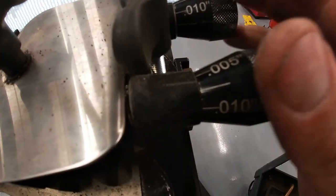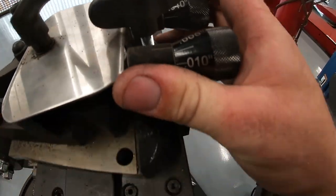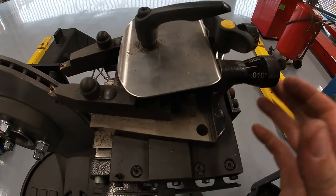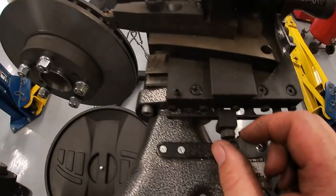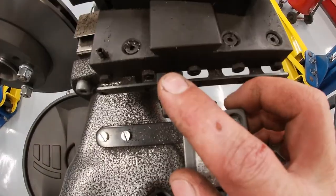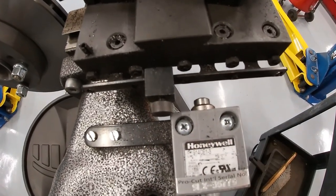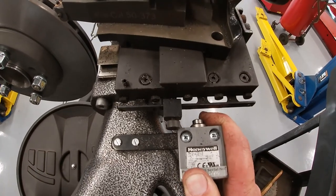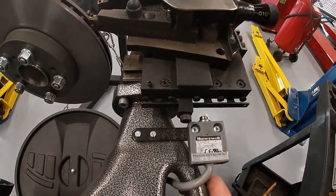The measurement adjustment is similar to an off-car brake lathe. You have a lock to move the cutting head inwards and outwards. What's different is we have this auto stop — a small thimble that connects to the auto stop and will stop the machining process once it reaches that button. So if you're not fully paying attention, it's not going to retract the head all the way out and drop the head onto the ground.